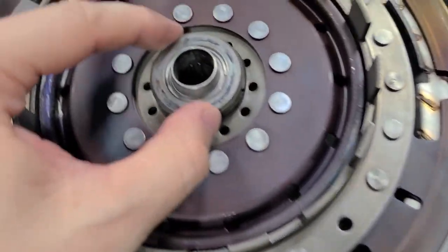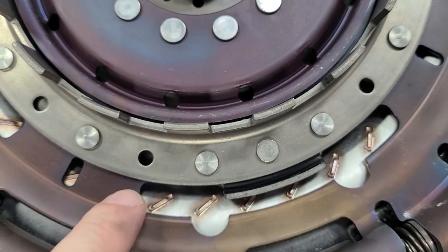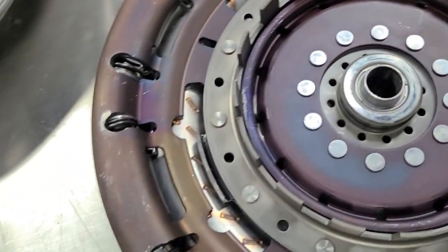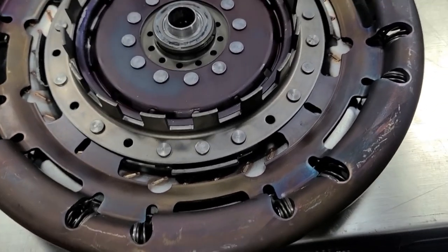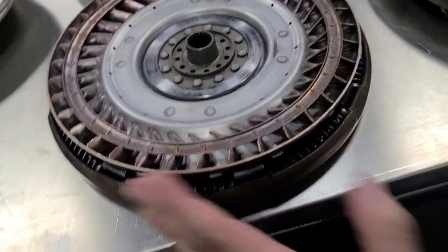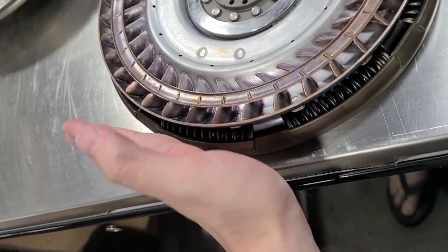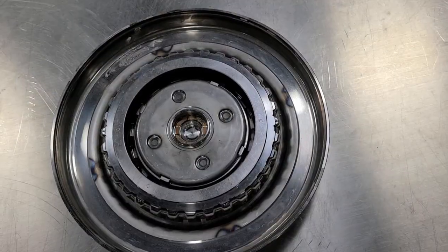The entire piece on the back has been heat treated. There's a sealing ring right there, and those fins on the back of the cover are likely brazed. This is what allows lockup to happen as early as five miles an hour without the car shaking like crazy — a lot of older cars that tried early lockup didn't have a damper of this size. On the bigger turbo cars the damper itself is a little bigger, the springs are bigger, and the converter runners go out further — done for strength and better torque multiplication.